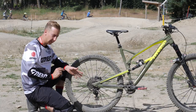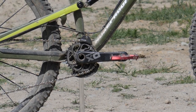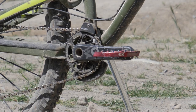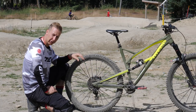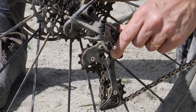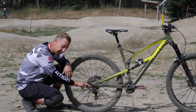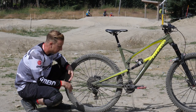Finally, look at the transmission of your bike and the cranks. Check the cranks aren't loose — the left-hand crank is normally the one that comes loose, and it's attached to the bike usually by an eight millimetre Allen key bolt. Check that, and also check your pedals are secure at the same time. On some bikes the chainring mounts directly to the crank, but if your bike has chainring bolts, they are a likely contender for coming loose. Make sure your rear derailleur is not damaged and is tightened to the bike sufficiently. Check the main derailleur hanger bolt — these often unwind on a long rough descent — and also check the hanger directly to the frame. Finally, check the jockey wheel bolts, because if your jockey wheels fall out mid-ride, you're probably going to lose your chain or it'll get tangled up.